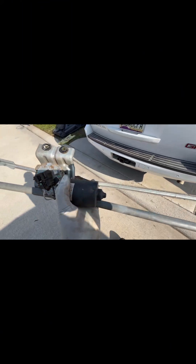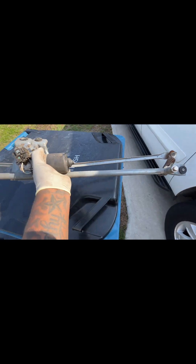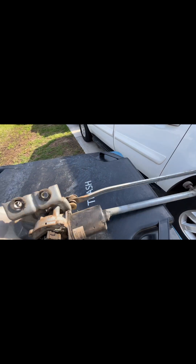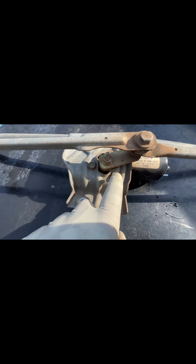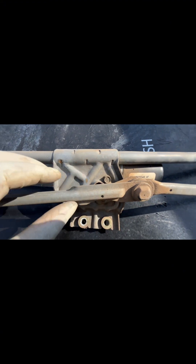Once you get the harness out, after you disconnect your two connections, the whole brace can come out of the vehicle so you can work on it a bit easier. I'm going to bring it over to my trash can so I'm not working on the ground. Now at this point there's a nut here — take that nut off — and then there are three bolts in total, and the motor will slide right out.